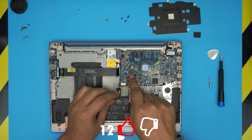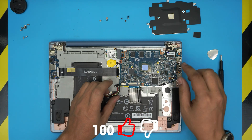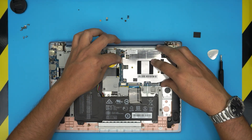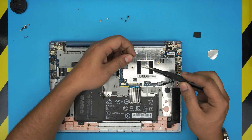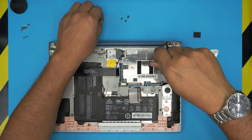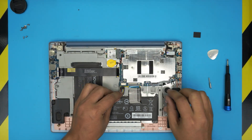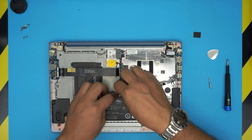So that's it — your only option is to upgrade the eMMC chip to a higher capacity, but you will need a technician to do the reballing for you. Now let's put it back together. Grab the heat spreader, align it evenly on top, put the three screws in the middle, and then the screws all around it.